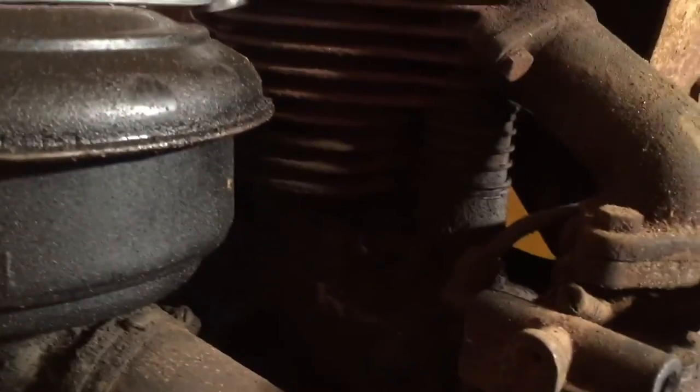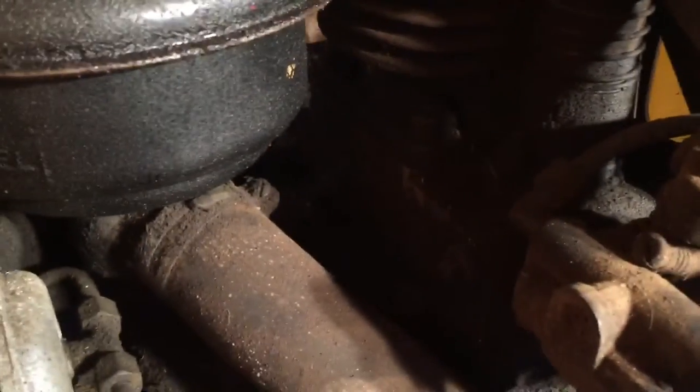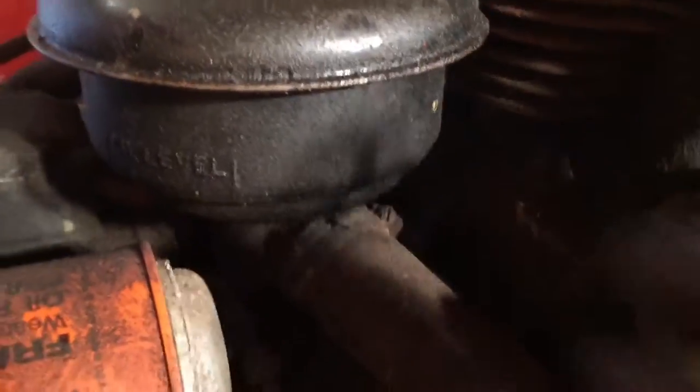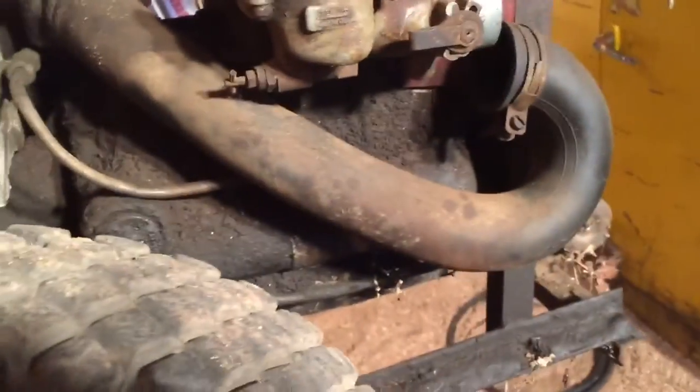Definitely have the old style lifters and access for the valves. Let me see if there's a port. Yeah, the camshaft is sticking out here. I don't know if you can see it, you can't really, but I'll have to get another light over here. If this is sticking out, that means it's basically a 5-horse. So yep, that's pretty much what we have.